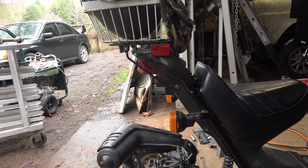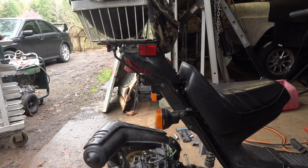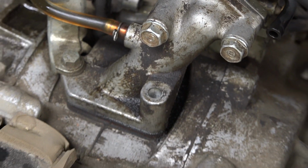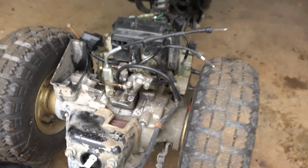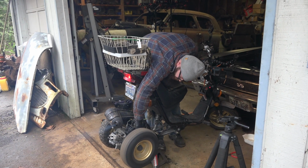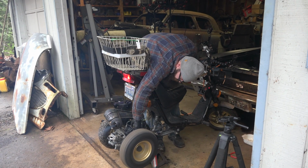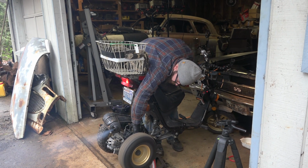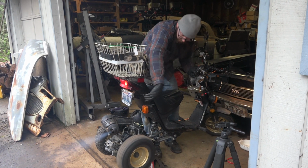I mean, it feels like it runs a little bit better. And by how much it's smoking, I feel like the mixture just isn't right. This thing has an automatic oiling system where you put two-stroke oil in one tank and gas in another, and it mixes the two in the manifold. It's actually a pretty neat system, but we thought there might be something wrong with it. So we decided to take that variable out of the equation by draining the oil out and mixing some 50:1 directly into the gas tank. Okay, super wacky machine, make us proud.